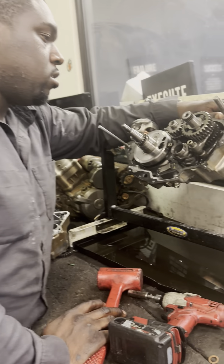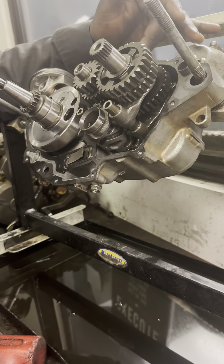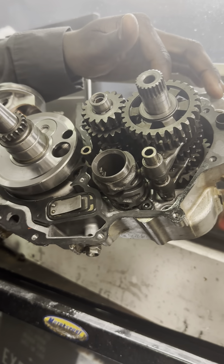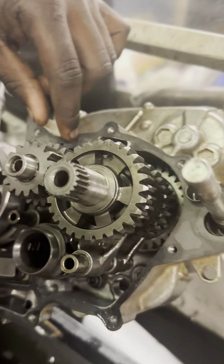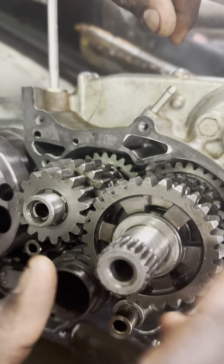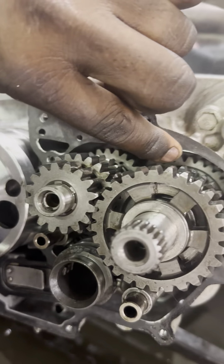We just had a situation where I had a gear in backwards, and to find that issue we had to run a diagram to see which one I put in. Simple mistake, but we got it right. Right now the bike is in neutral. As you can see, I can hold one shaft and spin the other one — as if you're rolling the bike back and forth — it's in neutral. The transmission is not turning with the clutch basket. It's just free, freelancing.